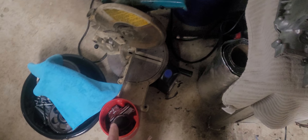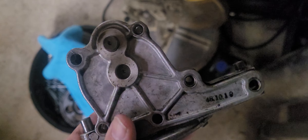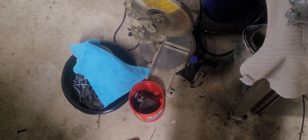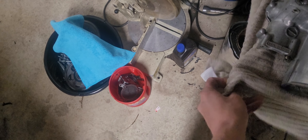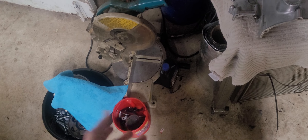The oil pump itself is right there. I actually had two bolts break in the oil pump side cover — you can see one right there, my thumb's over the other one. I could probably drill those out, but the long story short is I just ordered another used oil pump and gasket. This is a '74 oil pump; in '76 they changed the design a little bit, so I'm going to go with the newer design. It's a bit of a gamble with a used pump, but I'll take it apart and go from there.